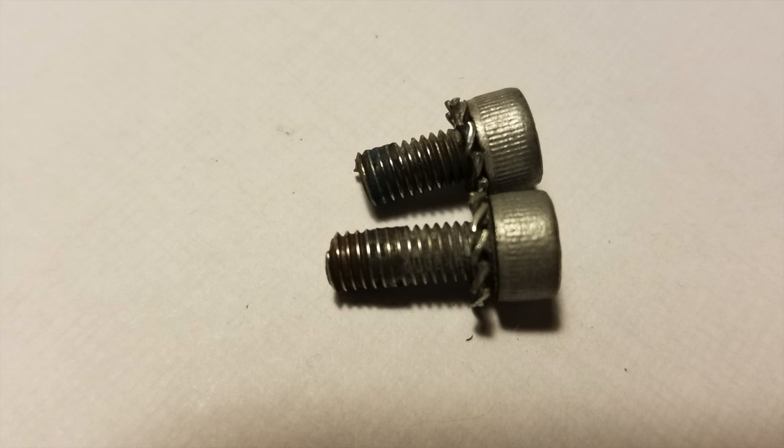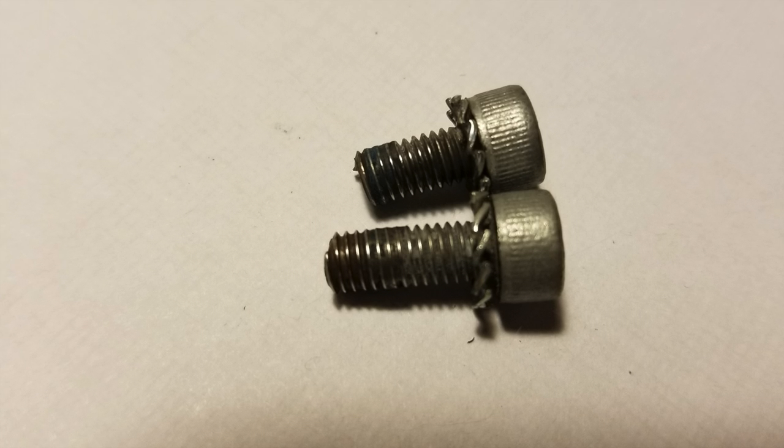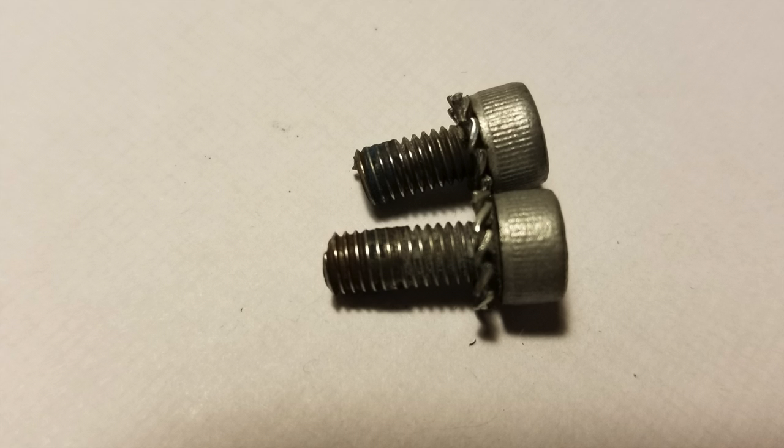I had mine loaded up with typically 13 pounds. When the bag broke, I measured the weight — it was 13 pounds. The official weight rating for the front carrier block from Brompton is 22 pounds, so I was way below that, nearly not much more than half of the maximum allowed weight. The problem was that I did not periodically check and tighten the screws, which is just so aggravating.